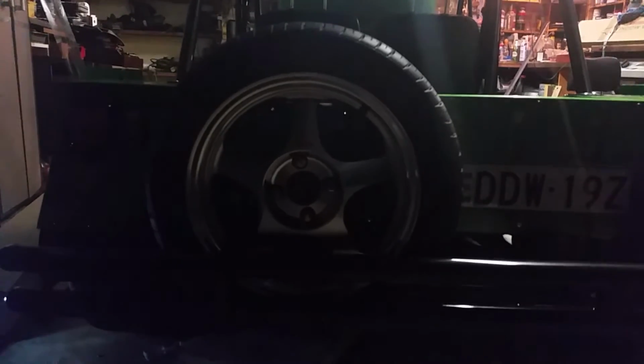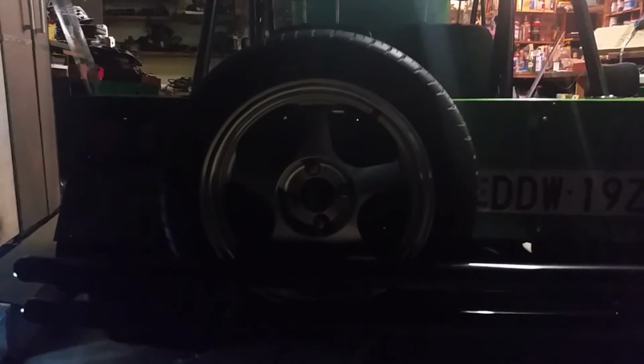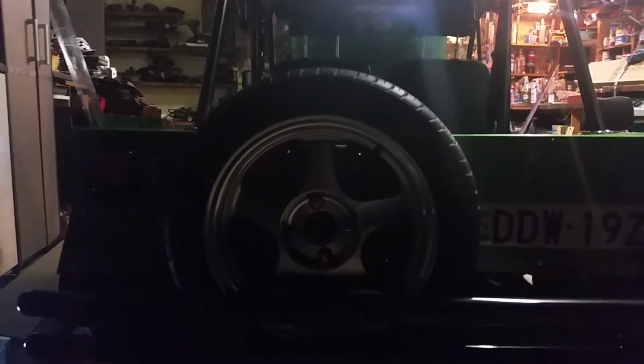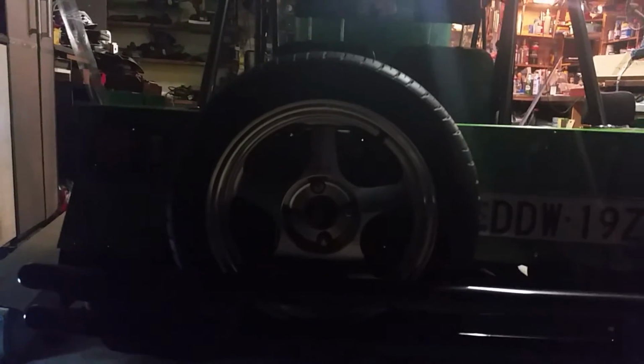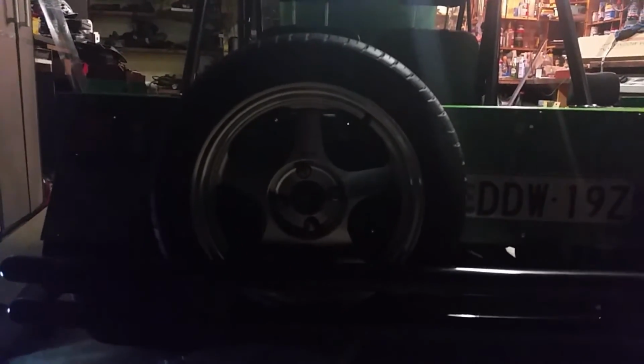As part of putting all the Honda bits and the wheel accessories, I suppose, the brakes and stud pattern on, I needed to organise a system to hold my spare. I now run 15-inch wheels, 195/50/15 tyres, which is not much different rolling diameter to the 13-inch that came out with them, but really close gearbox ratios to what Honda intended. So I've got nice cruising ability. I can use all 5 gears. First gear is usable. It's really fantastic. When I had the speedo calibrated, we were out by 6 kilometres. So really good result there.